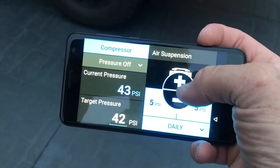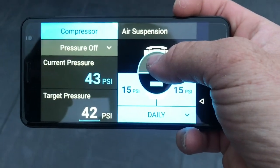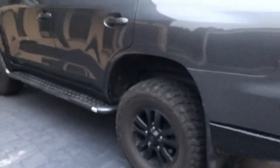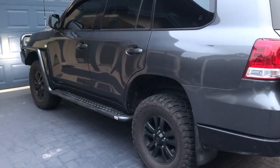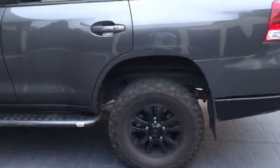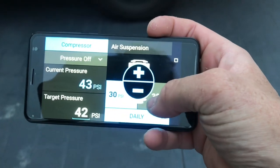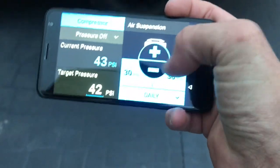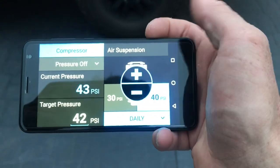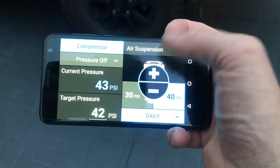A little video of the airbags. At the moment she's at 5 psi, so we'll go up to 30 — both sides up to 30. That's it, both sides at 30. We've got the fridge on the right side, so we'll put a little bit more air to allow for the fridge. 40 in the right bag, 30 in the left bag — that's it.